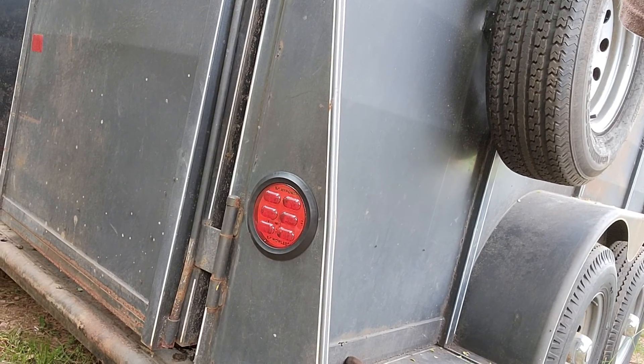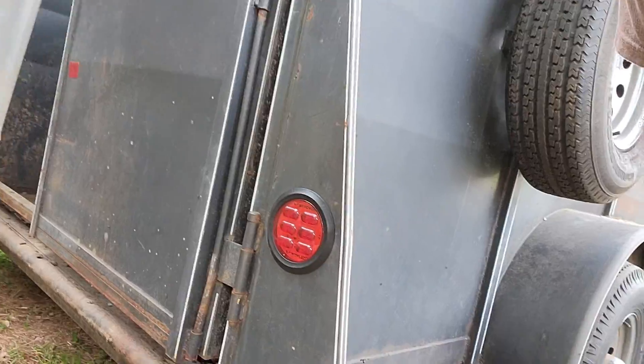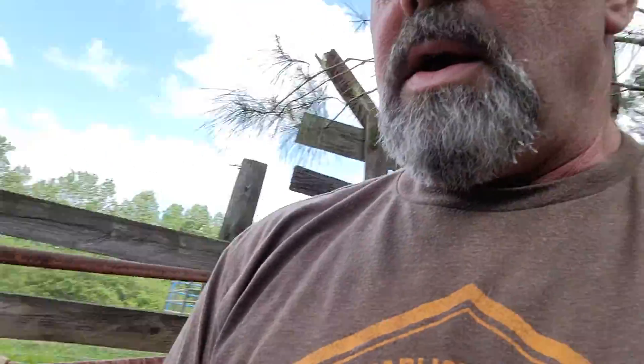We have no flashing now, and I know that was working before. So either one of those wires pulled out of that connector or it's not plugged up good. My next step is to unplug it, pull that housing back off, and make sure it didn't pull out. Have you got that side wired? I got the other side wired, this side not yet. All right, I'm going to put you on hold again and do that.